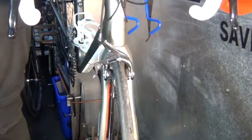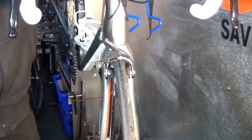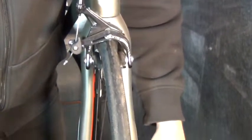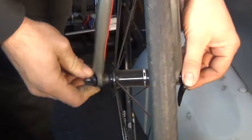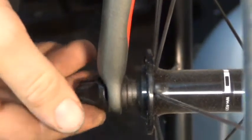The front wheel is very similar to the rear wheel. The only difference is you'll have to loosen off the quick release just a little bit here. Open it up, and if you have a bigger tire, you'll need to open up the brake as well. As soon as you open this up and let the wheel drop, you'll notice it's not going to drop — that's because there are little tabs on the bottom of the fork that prevent your front wheel from falling off when you apply the brake. You can see those tabs there, so just keep loosening off until you get past them.